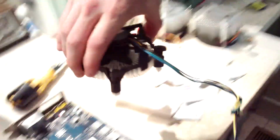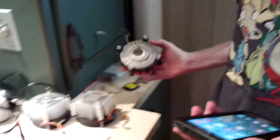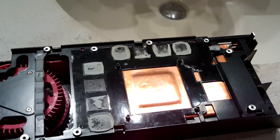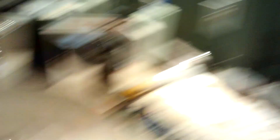We're back. I bought an aftermarket cooler for the graphics card — it's gonna slot right in. We might need to drill some holes but it'll work in the end. We took this thing outside and blew it out with the vacuum, so the heat sink is actually clean now on the inside. We're just not going to worry about the thermal pads since we don't have any on hand — we'll just stick it on there and see if it works.